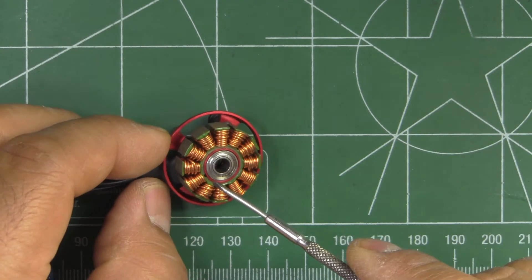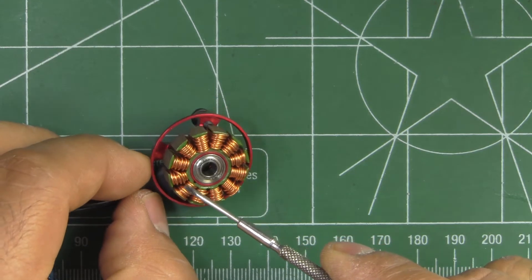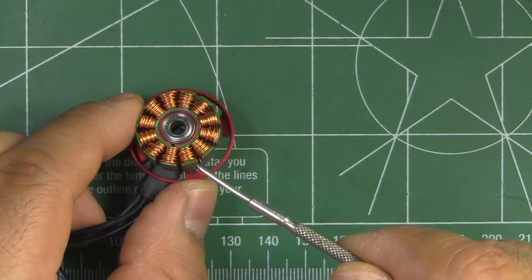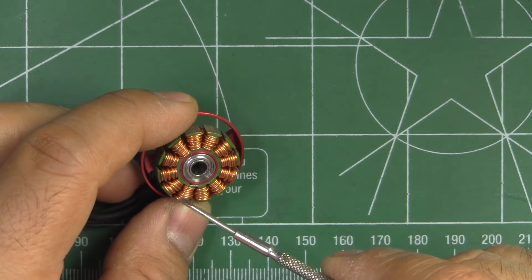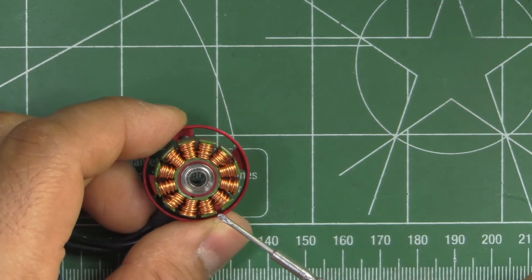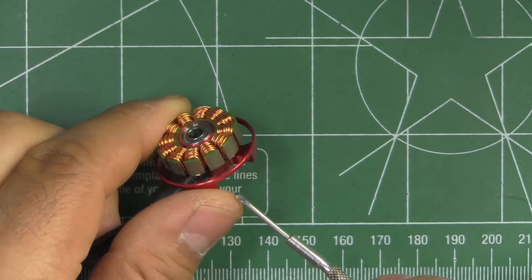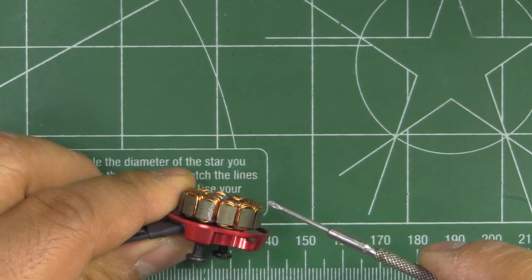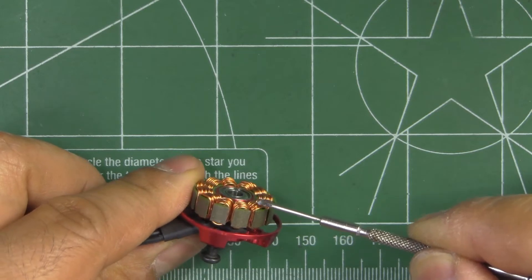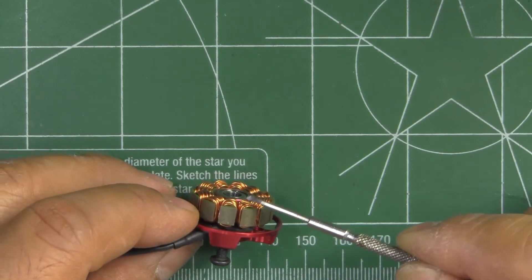The windings are single-strand wire, somewhat thick — not overly thick, but not thin either. They're saying it's a high-grade wire. The windings are not too bad, not the prettiest I've seen, but they look alright. They do bulge out a little bit on the top and bottom, which is what happens when you use single-strand wire, so there's no way to avoid that.